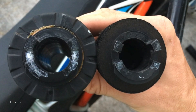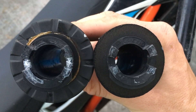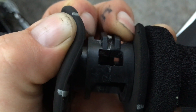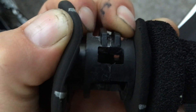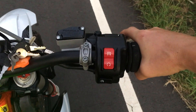One little difference is the tabs at the top are a little bit bigger than the 690's tabs. The only thing that affects play in the throttle is this gap right here — there's one on each side — and it appears that gap is exactly the same on both throttle tubes. I can confirm that the KTM 690 throttle tube does work for the Freeride EXC.